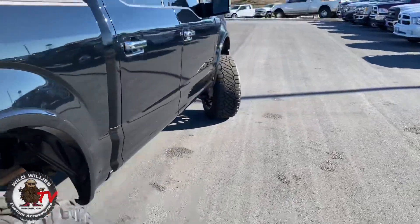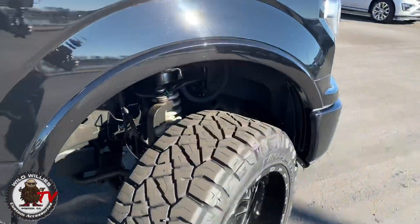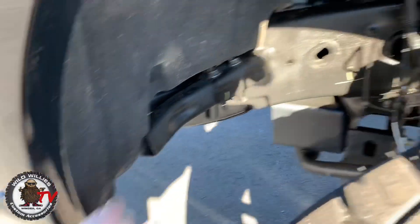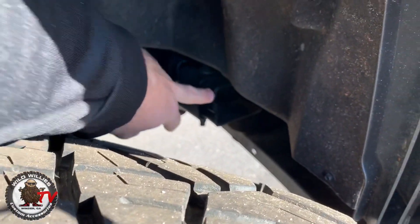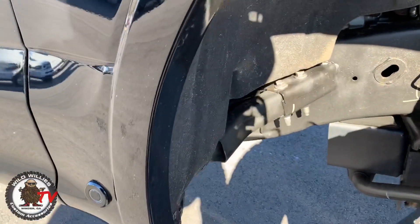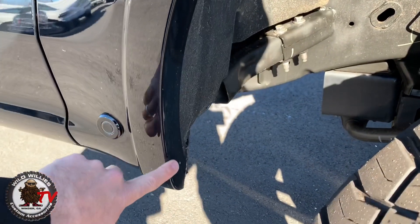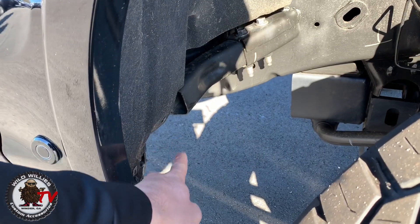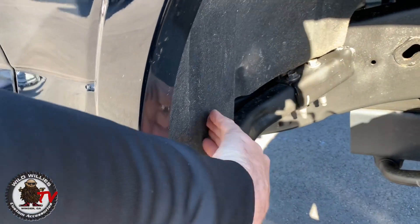How do we get it to work on just a four-inch lift? We removed the crash bar in the rear and also removed the crash bar in the front. In the back, we had to trim some of the actual plastic on the fender flare — trimming across, down, and through here — and used some screws to push the inner fender well back so there's no issue there.